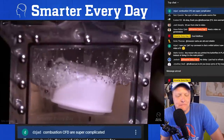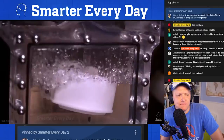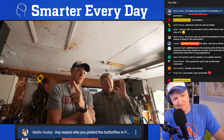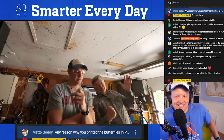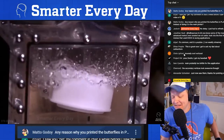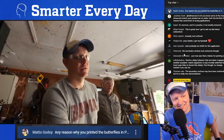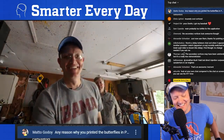The mechanical oscillations are way more violent than I expected. Well, the engine's running pretty fast right there. Each time you see a shake is a stroke, isn't it? No, I don't think so. I think it's a vibration mode, a harmonic. Well, there should be four: intake, compression, power stroke, exhaust. So yes, you should have four strokes for each. And you do have, if you look at it right there. One, two, three, suck. One, two, three, suck. It's top dead center and bottom dead center. You're pretty smart for a redneck. Well, that's why they call it four stroke.